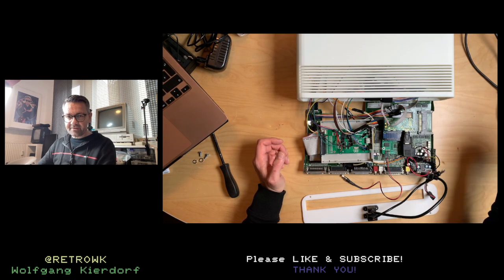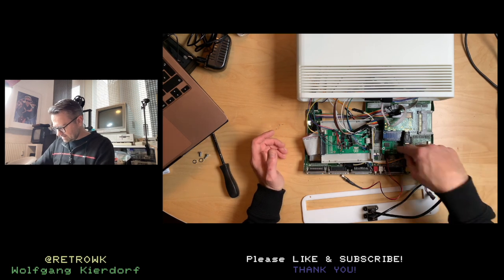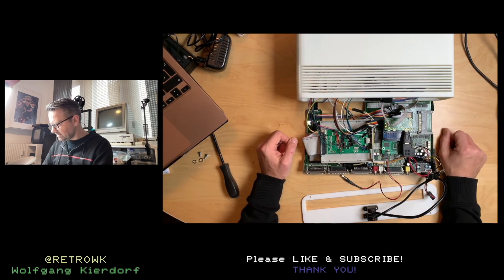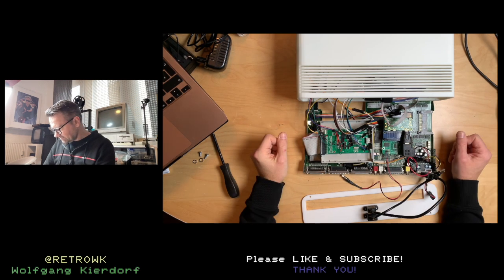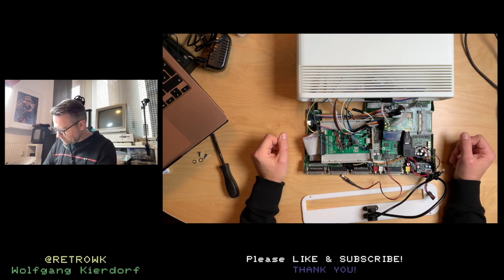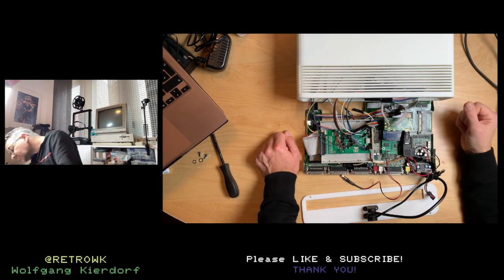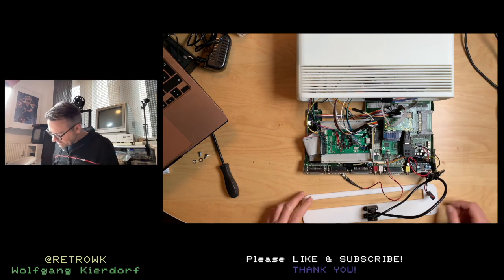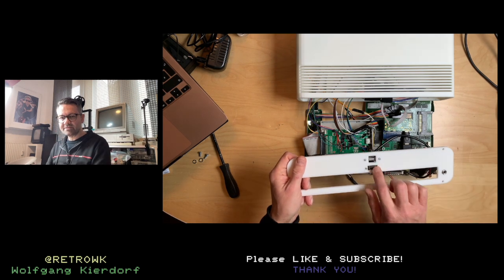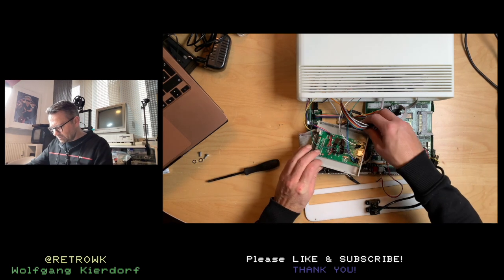Copy the Amiga config file from the Amiga folder to the root folder of the SD card and off you go. But it doesn't stay in place, it always comes loose, and then the Amiga doesn't boot. So I have to think how to put this in place — I can't screw it in, there's nothing to screw to, can't drill a hole into the motherboard. Could hot glue it but that would be a very imprecise solution. I did put in the HDMI port here which was unpopulated up till now.